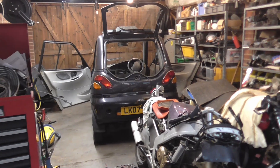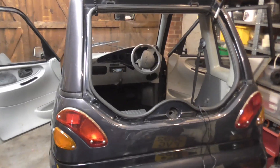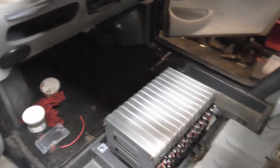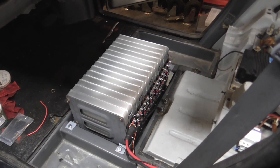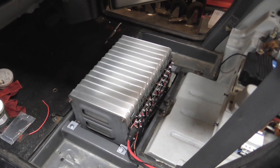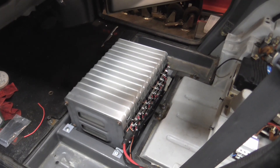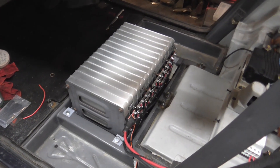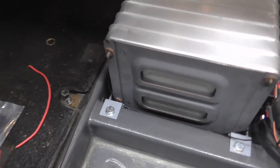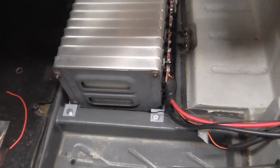This one was saved from having a motorcycle engine put in it. The people involved decided it was a little bit too nice and a little bit too much work. It came without batteries, and as you can see I have a different battery pack in here. I have a set of 14 Leaf modules, which gives me roughly equivalent to the original 48 volts — a little bit higher — and these are mounted on a steel frame bolted down into the chassis rails.